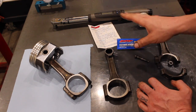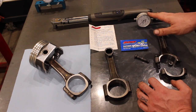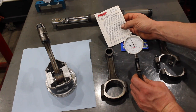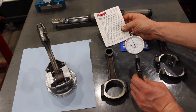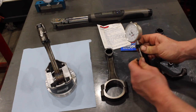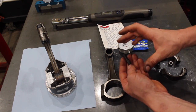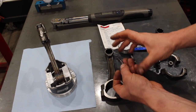That's okay if that's the way you want to do it, but hopefully you're using a bolt stretch gauge. ARP recommends using the stretch method when tightening bolts, following the instructions for using a stretch gauge — stretch bolts to 5.5 to 6 thousandths of an inch. When you tighten a bolt, the bolt actually stretches. The clamping force is created by the bolt stretching on your rod.